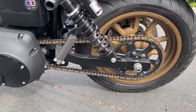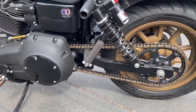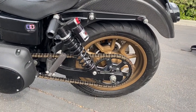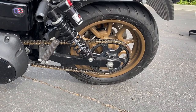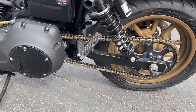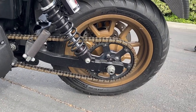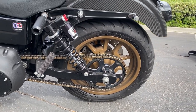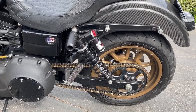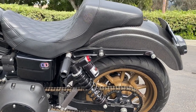The chain kit — look at that thing. Why did I get a chain kit? Well, chains look way more badass, and that's why I got it. It also adds a little bit of torque because you don't have any stretch like you do with a belt — just instant torque. This is the TMF kit. He doesn't sell this specific kit anymore, but if you're looking at getting a chain kit for a Dyna, FXR, or whatever, I recommend TMF. I've got about 15,000 miles on this chain kit with no problems. Also, if you want to get one installed and you're in San Diego, hit me up — I'll give you a deal.